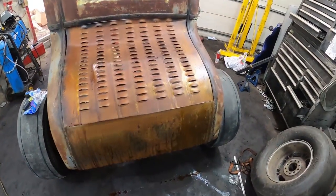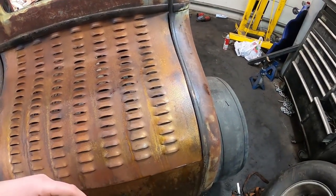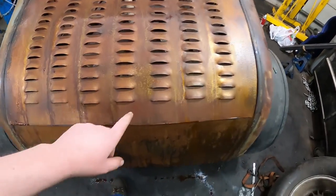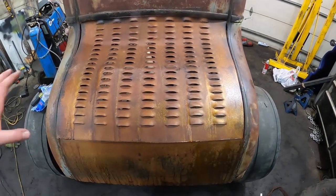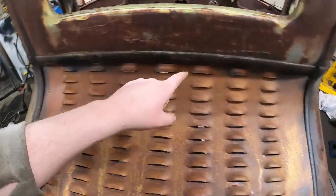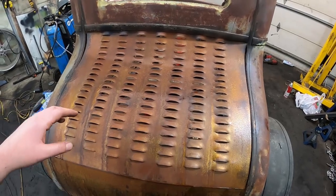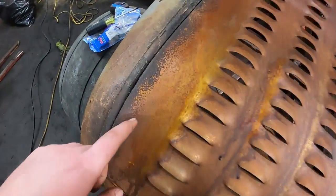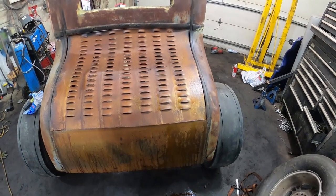All right, guys. Gonna level with you. It's still a little wet in certain spots. So I was spraying with the concoction there, and it was definitely making it rust, but it was more of a light rust. And obviously to match the rest of the car, we need some real heavy rust. So while it was still wet with the solution, I sprayed the edges with some flat black, and a little misting over the deck lid, and then a little misting of the red oxide primer. Then I shot it right away, so it broke all the paint and stuff up a little bit. And I didn't do any filming because I didn't know what it was gonna look like.